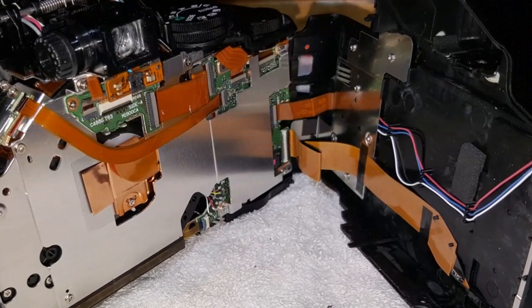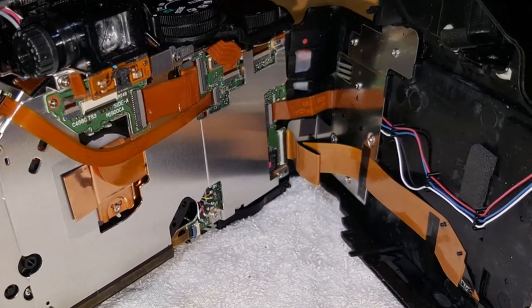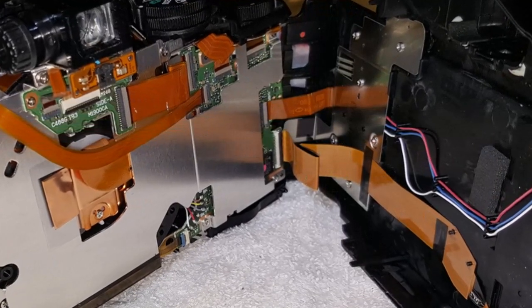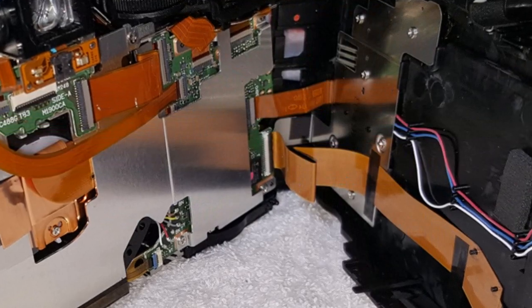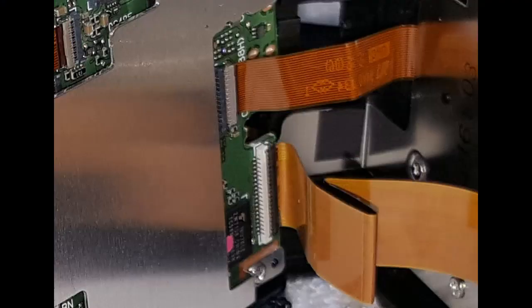Got to be a little careful because there's two flat flexible leads — FFC leads — on the right hand side. On the FFC connectors there's a little flap. Insert a spudger under and you flip it up and away from the FFC. Once open the FFC will slide out easily. You disconnect both and then you can place the back safely to one side.